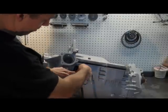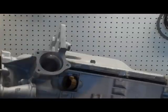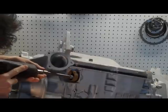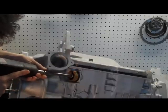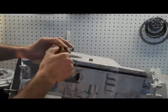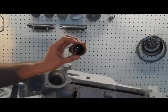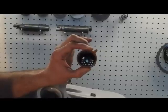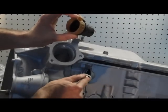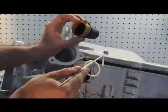The first thing we have to do when this thing's in the car is take off this connector. Now this connector also plugs into the valve body inside, so what we have to do is use a 7mm bolt in there that we have to loosen, and then we pull the whole connector out. And that's the bolt. In addition, you're going to have two O-rings that sit on this thing. Take those all and put it on the side for now.